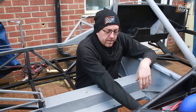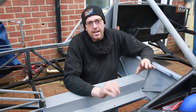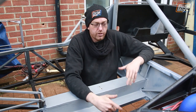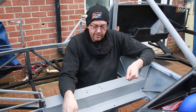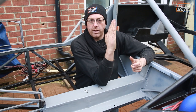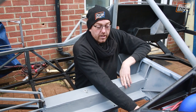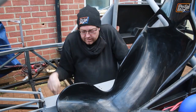We've already got two harness bolts in the side of the car from the original build, but because we've moved the seating position forward a bit I think they're going to be at a little too shallow an angle. The MSA regs have set distances and angles you need to mount all of your harness points to so that you don't fall out of the seat and it actually holds you properly. So we're going to pop a seat in the car, set it down in my position, which will give us the most upright position for the harness mounts — probably around about here — and compare that to the one on the back outside of the car to see how much further forward we need to move this, if at all. I'm hoping we don't have to, but I'm pretty certain we're going to.